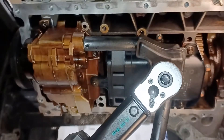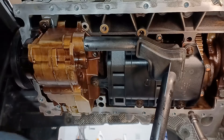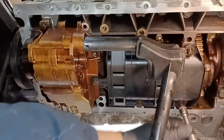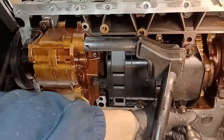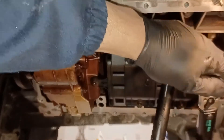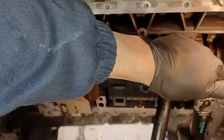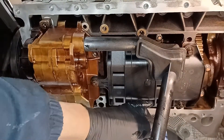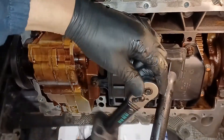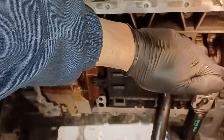So that's a limitation of that torque wrench - it won't do anti-clockwise torque. Just a word of warning there. Now I've got to do these pickup bolts up to 25 Newton meters - let me just check I've got it set correctly. When you flip the lever it will let you undo bolts but the torque setting doesn't work in that direction. I need to be careful not to damage this pipe. I also put a very small amount of blue Loctite on these as they're going into castings.